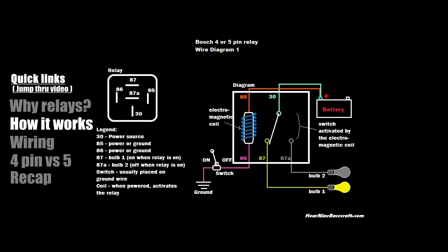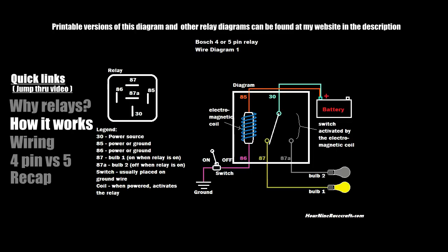That is why you would want to use a relay — it saves money on electrical wire, because copper isn't cheap. Instead of running heavy gauge wire from the bulbs all the way to a fat switch in the interior and then to the battery, you just run a small wire over to a toggle switch.